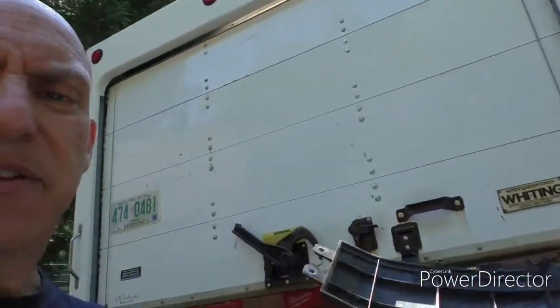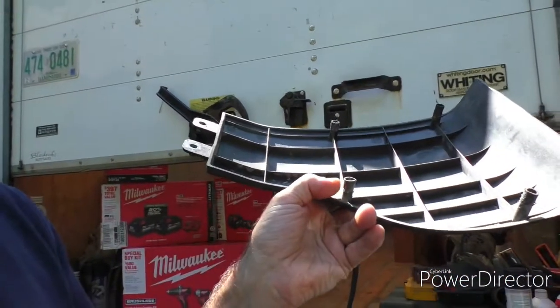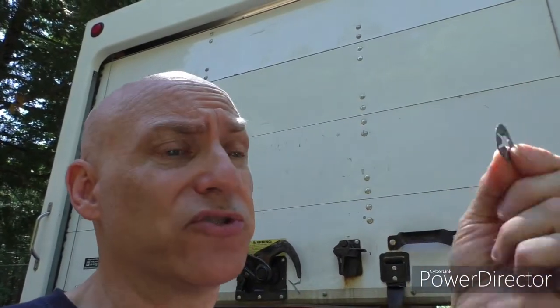Here's what I did — I basically took it off. I was debating whether to paint it on, but that meant a whole lot of masking. When I crawled underneath, I noticed all these panels have little tabs, and they're held on with little press fittings — little star fittings that just press on and lock in. They don't screw on. I found that if you put a screwdriver in between the little slots, you can pry those out.